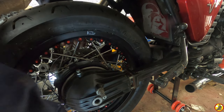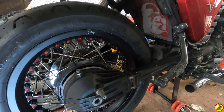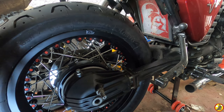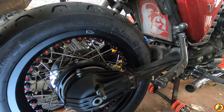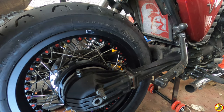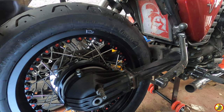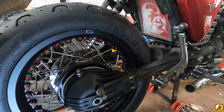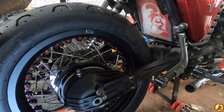Oh, say that, that wasn't too hard at all. Now the wheel isn't balanced very well, but it should be easy enough to put it back together again. Obviously I need to push the cush drive in further. I also need to get the axle through the wheel, and the spacer on this side, on the opposite side of it. But yeah, this isn't actually too difficult a job. It's just fiddly, and winter sucks doing spannering stuff. But we're getting there. We're getting there.